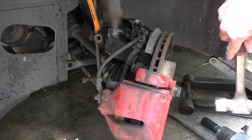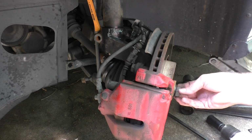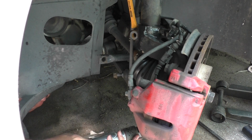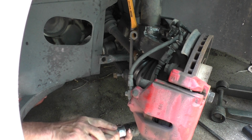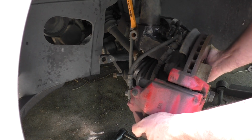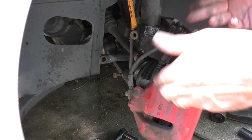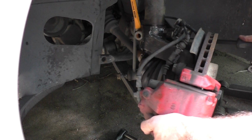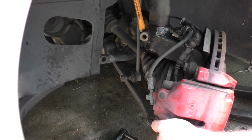We would hope that that'll just, yeah, so the axle's loose. So we're good on that. I'll leave that in there for now. Down here, right below at the ball joint, there are 3 bolts, 3 nuts that hold the ball joint in. Those are 15s. And that should allow this knuckle to pry up out of the control arm. Should. All right. So that popped out of there.